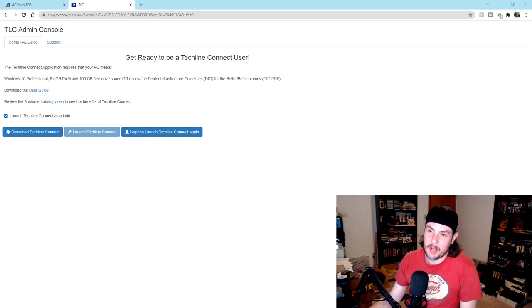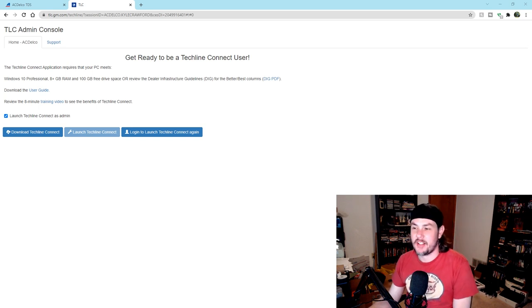And it updated the wrapper again. And that's the J2534 wrapper that is used to interface with the CAN bus interface. Software updates just checked out good. Now we'll see whether or not it's going to let us in or if we're going to have to re-log.